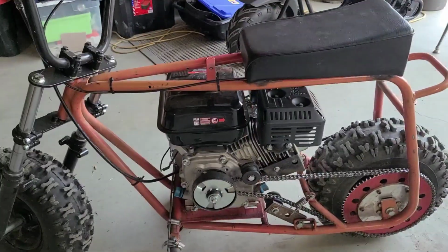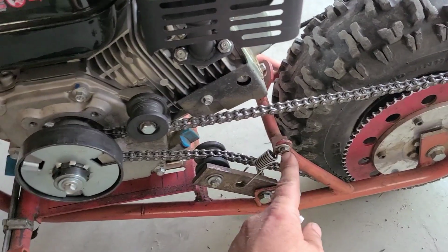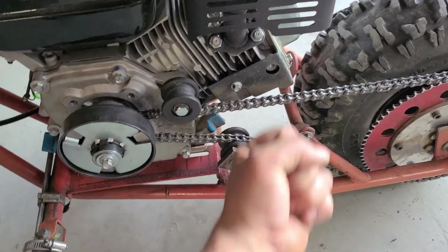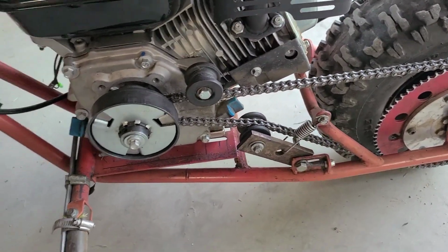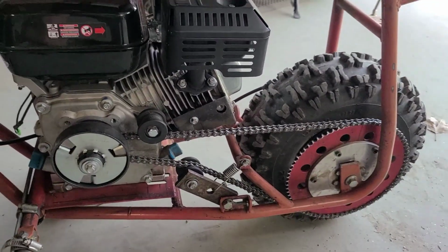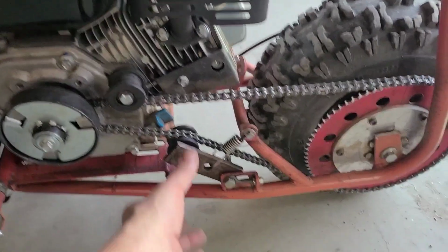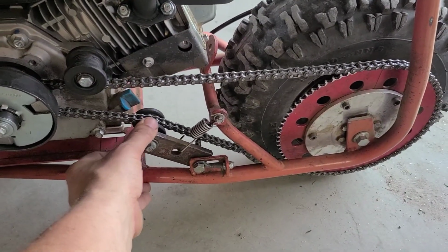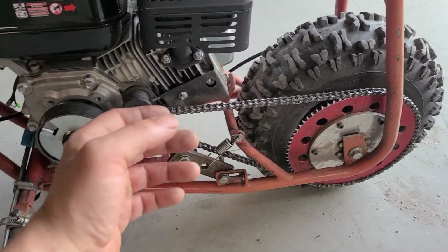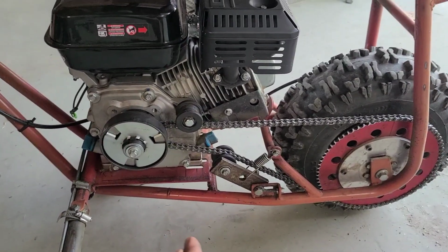Problems that we're having with the chain tensioner. Okay, I took out a 10mm. I loosened this up a little to see if it was a pivot thing. Maybe it was strong arming itself at some point and pushing the chain off. Not the case, okay? So what we have is either not enough flex with this idler wheel up here, okay? Because see how the chain moves with the derailleur? We either have too much tension or not enough play, believe it or not, okay?